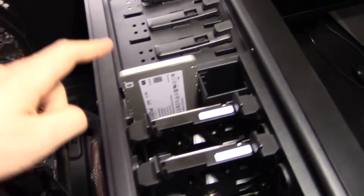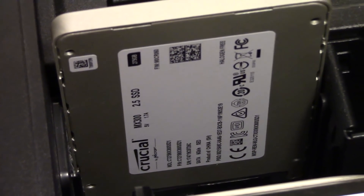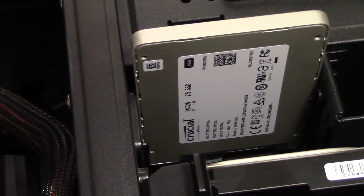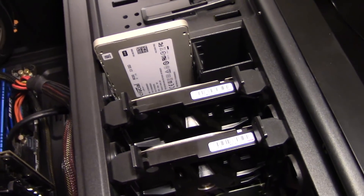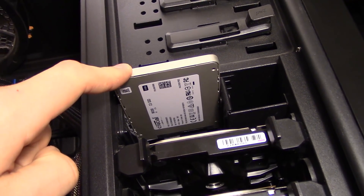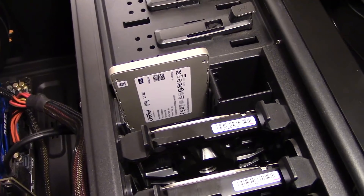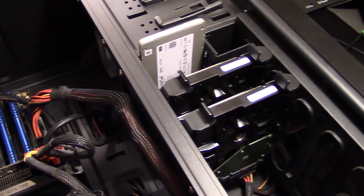So starting off with what I've upgraded in the past six years: the CPU is the exact same, memory is the exact same. The SSD — back in 2012, SSDs were just becoming a thing and I bought a 64 gig SSD, which is tiny. I still have it — I think it's a Crucial M4. It's slow and basically useless because it's so small. I upgraded to a 240 gig SSD in late 2013, then recently to 280 gig because my girlfriend's computer really needed an SSD. I figured I'd buy a new one, give myself the new one and give her the hand-me-down. Right after I bought it for about 90 bucks, they announced the MX500 series — now you can get 500 gig for $115. But I needed the upgrade at the time, so it was worth it. That gives me about 500-600 MB/s read — not as good as NVMe, but that's overkill anyway.